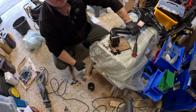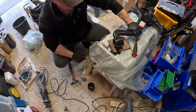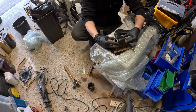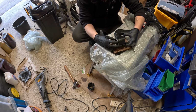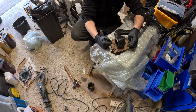which is a slight problem when you've got a reciprocating saw, because it is just fast, if that's the correct term to use. So I reckon at the moment, with that shell left in there, if we just put a puller on it, I'm thinking it might just come out easily, because we've got rid of all this complicated bit at the front. So let's have a go, see whether that will pull out.